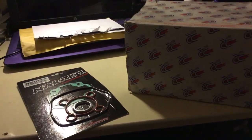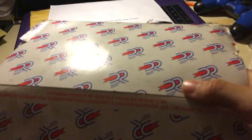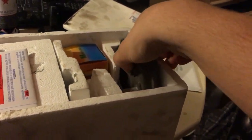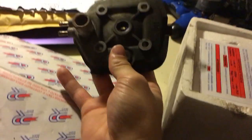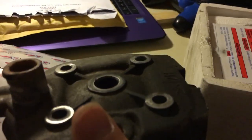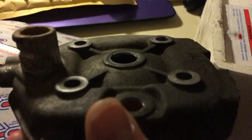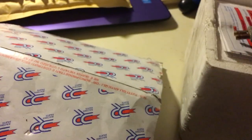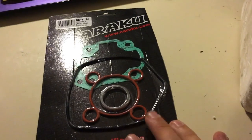In this video I'll be going from the DR racing kit back to the 50cc original out-of-the-factory liquid-cooled kit. It's completely stock — the reason being because the threads for the spark plug are completely stripped on my DR70, and I'm going to be getting it helicoiled. For the time being I've just bought a gasket set and I'm going to be putting the 50cc back onto it.